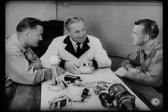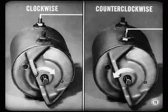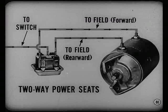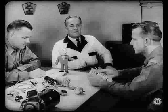Now let's look at the reversible electric motors that operate power seats, power windows, and convertible tops. This type of motor has two sets of field windings. When one field is energized the motor runs clockwise; when the other field is energized, the motor runs counterclockwise. A two-way switch controls the direction of rotation. On two-way power seats, the switch and circuit use three wires: one wire supplies current to the switch, one sends current to field windings which move the seat forward, and one wire goes to the other field windings which move the seat rearward.